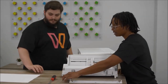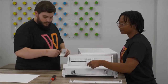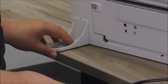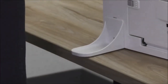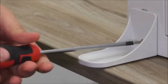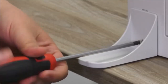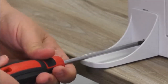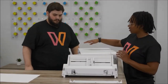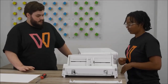So Evan, could you take this little stabilizer here? You're going to get a screw with that, and you're going to need a Phillips screwdriver. You just kind of set that in there on the back and screw that in. You'll notice as you're printing through the bypass tray, you may see some of it shake — that's just because of the weight. This just helps your printer stay in place on whatever surface you have it.